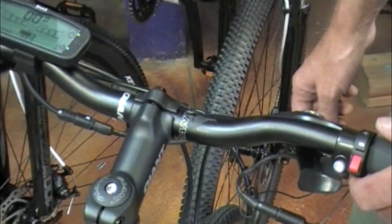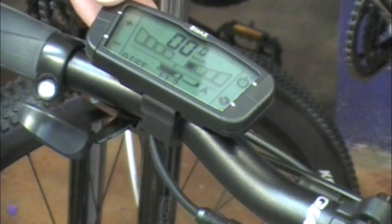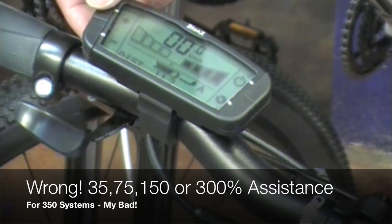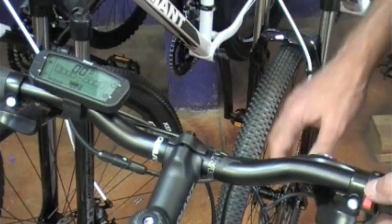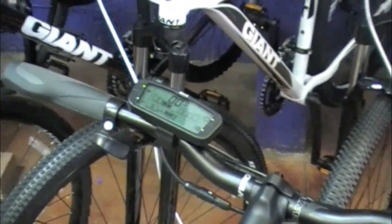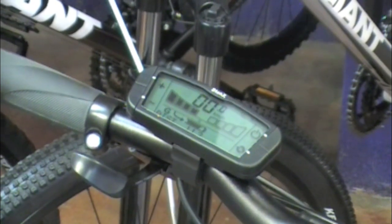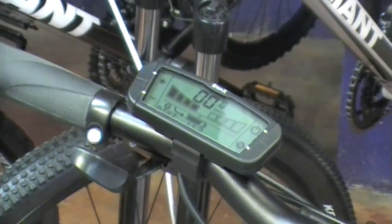Once the system's on, the first thing we'll do is determine how much assistance we want. We've got four levels of assistance. Hit the plus key and you see the little 'A' turn on, meaning we've got assistance — 25%, 50%, 75%, or 150% assistance. We can also use the remote throttle button to adjust that. If we hit the minus key, we start backing off on assistance — a little bike icon shows up showing it's just a bike with no assistance. If we keep going negative, you see a 'G' pop up, meaning we're in generator mode. Now we turn the motor into effectively a brake that generates power for the battery — four levels of that. It's handy on long descents, easier on braking and it puts power back into the battery.